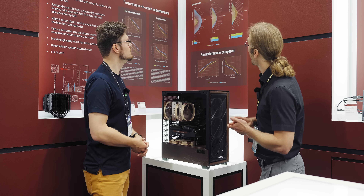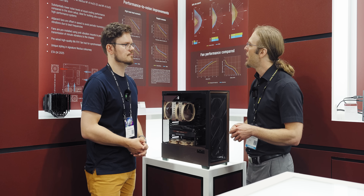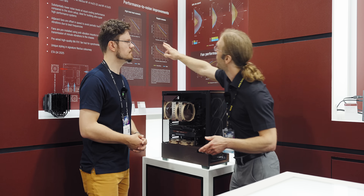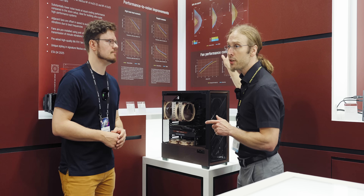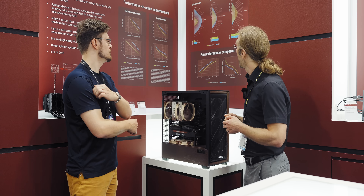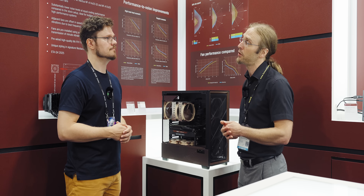When looking at the 100% results, it's also important to keep in mind that with a very high heat load scenario — heavily loaded or overclocked CPUs at 200W or more, plus a 5090 — then even at 100% fan speed, you are seeing massive temperature differences. So while the raw noise benefit may not be there, you still get much lower temperatures at that noise level. We feel that even if you need to run 100% fan speed, it's still going to be a good choice as long as you have the heat load that really requires those fan speeds.